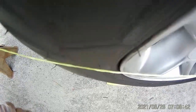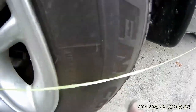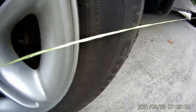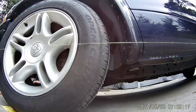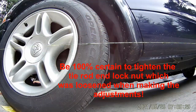You can see there's no gap here in the front now. Before, when I touched the string, there was at least an eighth of an inch gap — now there's no gap. It's just barely scraping it. This isn't the best string because it doesn't lay down perfectly, but if I hold the front one flat with my finger, you can see it's just right there, barely touching — and that's what I want. I'd rather have it a little bit toe-out in the front than toe-in, so I'm going to leave it just like that. This side, I'm going to call it done.